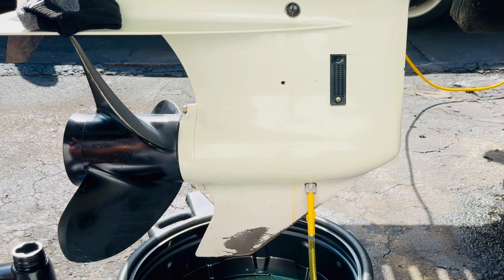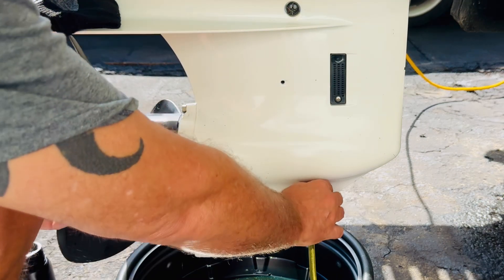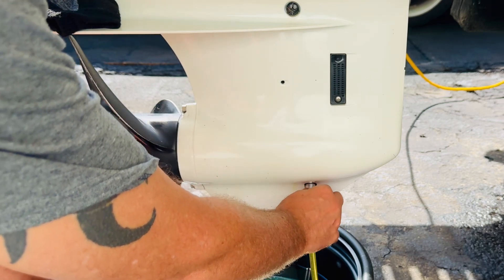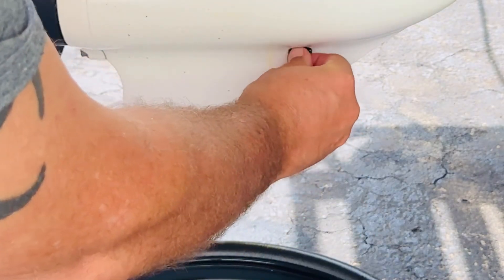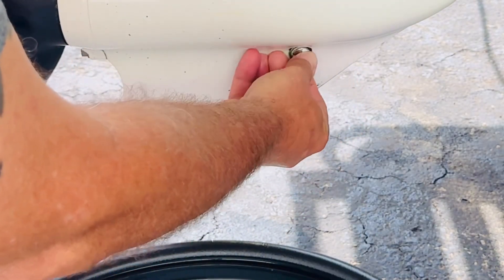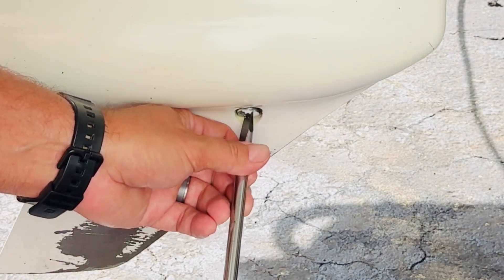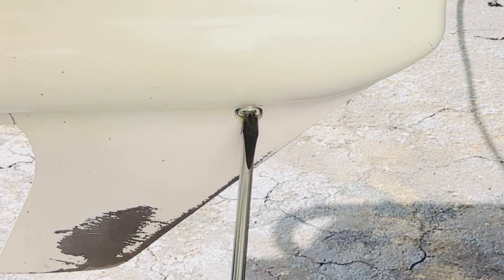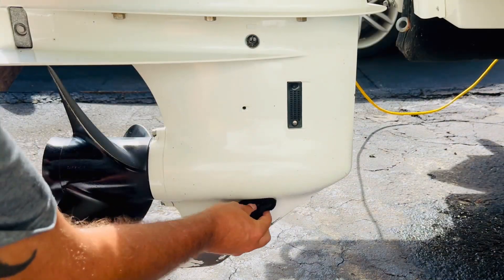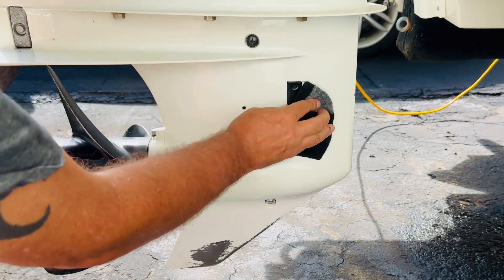The final step: have the bottom plug in your hand, then unscrew the pump fitting. You'll lose just a smidgen of oil — that's fine. Tighten the bottom plug down, do a final wipe of both ports and the surrounding area, and clean everything off really well.